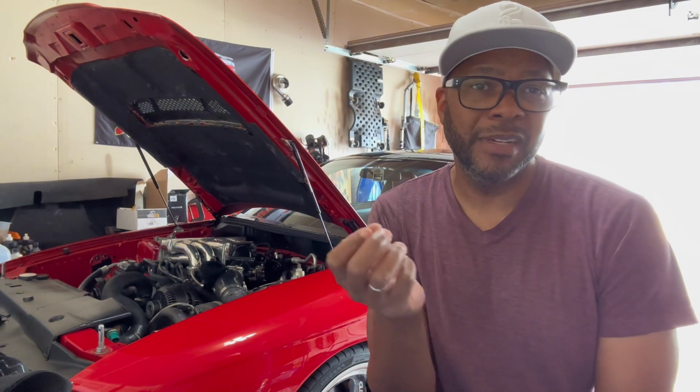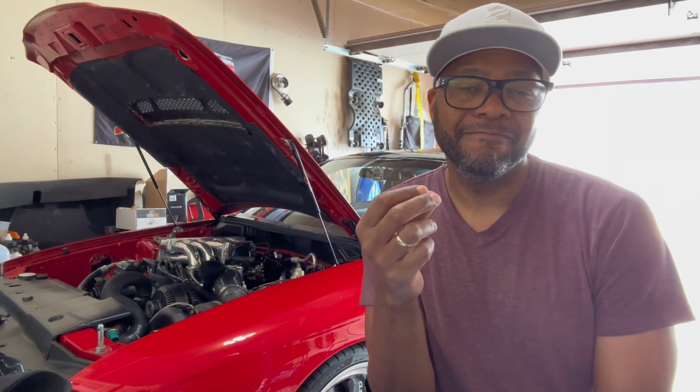But going through some AEM documentations and videos, they talk about when you get that oscillation on these turbos, you back the spring value down, and you just kind of got to play with it until you find that sweet spot. So I think with this setup, like I said, 5.6-ish is pretty nice, and the duty cycle at 15. Now, I think max boost with this setup, I might hit 10. I don't know. I was kind of doing maybe 3/4 throttle pulls, between half and 3/4 throttle pulls.